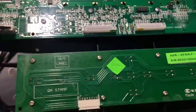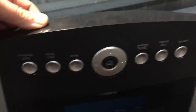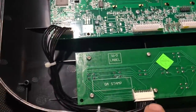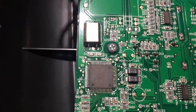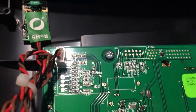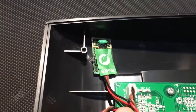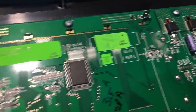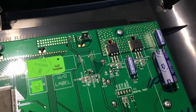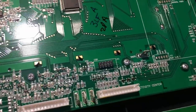Let's see what we've got in here then. This looks like the keypad on the front of the screen with those controls on it. We could unplug that to rule out this keypad. On this board we've got a microcontroller - looks like an Atmel - a display driver chip, what looks like a linear power supply with a couple of capacitors and voltage regulators, and a couple of logic chips. That's about it really, there's not much else on here.